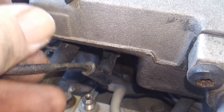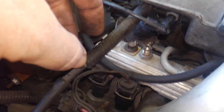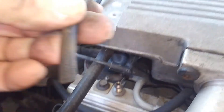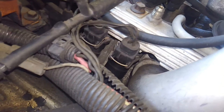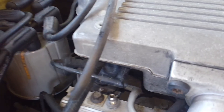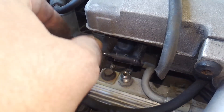You can actually buy repair sections for these pieces. You can see how this car had some smoke damage — it's all molded and semi-melted, in pretty rough shape but still intact for the moment. Sometimes you'll find repair sections on eBay; they do make a way to repair these. GM loved using these vacuum systems in the '80s and '90s. Even the ZR1 of the '90s utilized the secondary throttle system, because it has 16 fuel injectors, and believe it or not the entire secondary throttle system is run with hard plastic vacuum hoses like these — fairly sturdy, but we're talking 30 years old now, and they've just started to wear out.